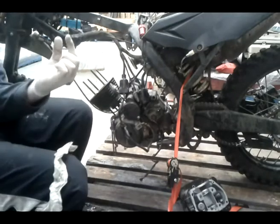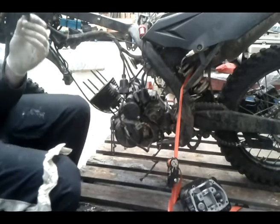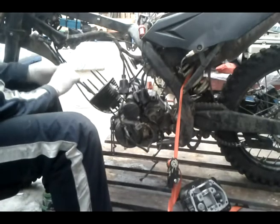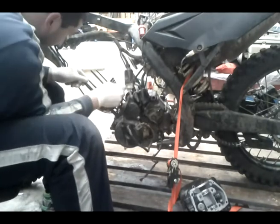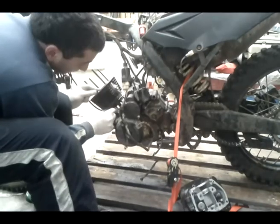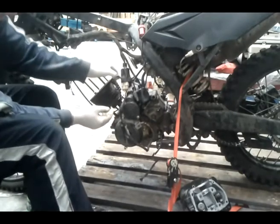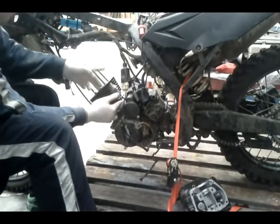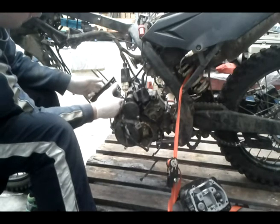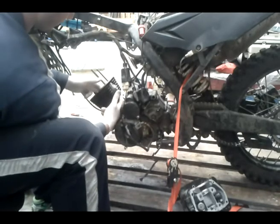This little hook here goes in a little thing like that, so it doesn't move around. So you got to push that into there. So bring it from the top, lift the chain out of the way, and you can see it with some lighting. See, well, it's not moving around, that's in. Slide the chain up from underneath. Bit of wire helps. You can do it just like that.